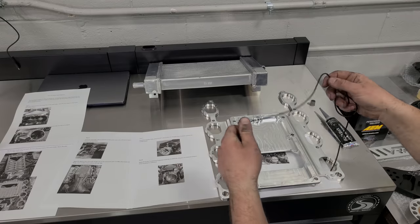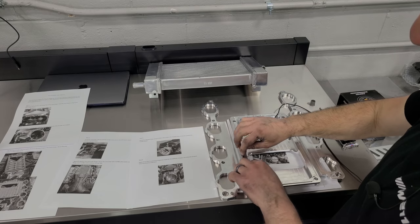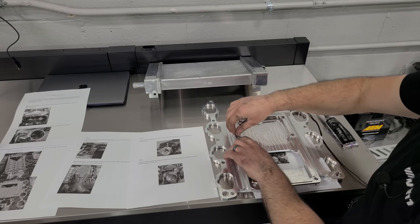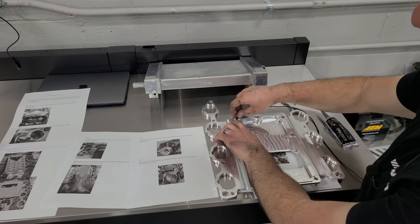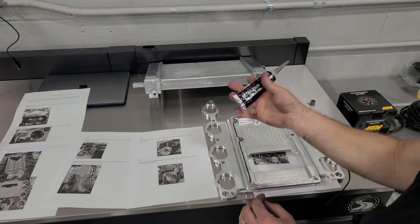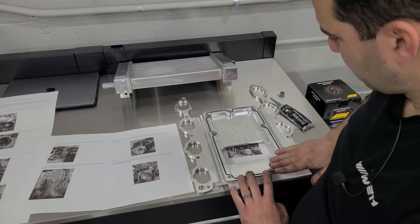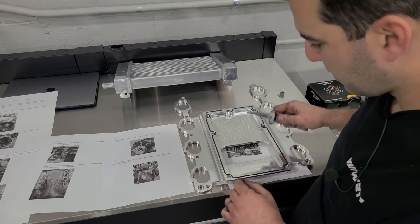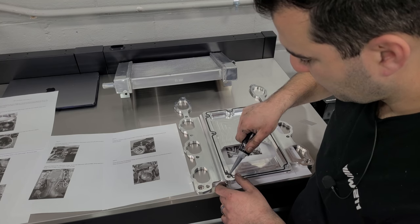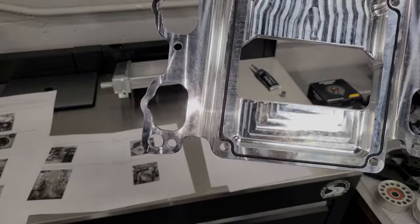You do get instructions on how to put the Whipple together, and they give you a base plate seal that just slides in. Make sure to go around all the little bolt holes and slide this little seal in nice and pretty. There's going to come a point where the two ends meet, and at that junction we're going to add a little bit of RTV right where these two meet. Just a little dab there. And just like that, we have conjoined the two ends of our seal.